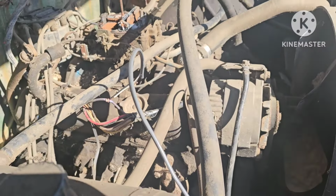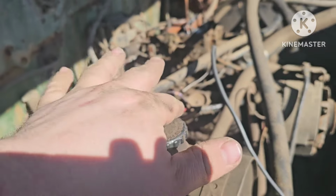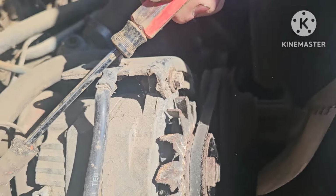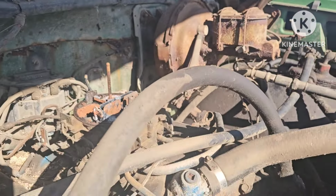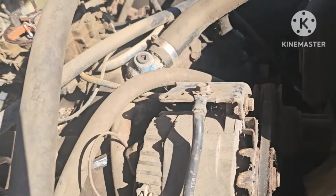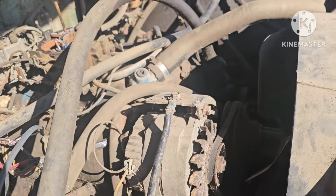So now I'm gonna focus on getting spark. And get spark and fuel, make it run, then maybe I'll probably not, but anyway, let's carry on. I don't know if you can see it, but you should at least hear the snapping. We got spark, so that means something in the dash is doing what it's supposed to. Might just have to look at that slider thing in there for the ignition. Might not be engaging, but anyway, so we got spark, it whirls over. Let's give it some fuel and see if she'll roar to life, I guess.